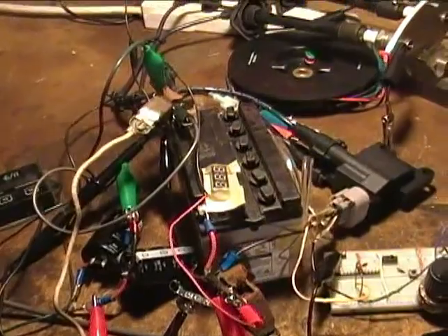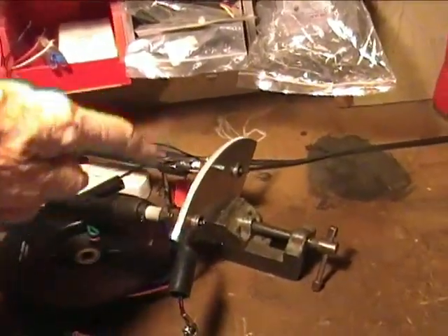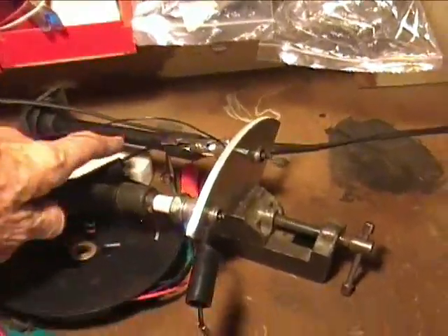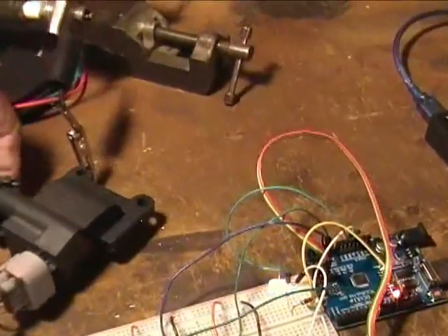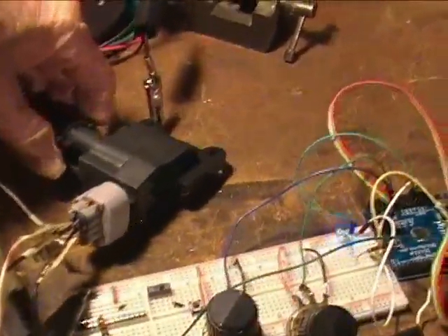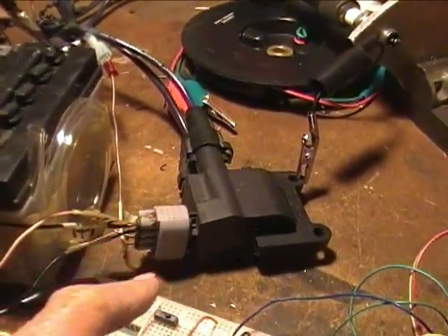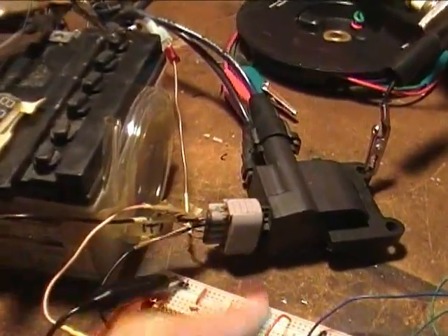This is a look at the hardware. Here we've got two spark plugs hooked to a grounding material, with coil near plug wires coming to the coil near plug coil. This is the input connector with four leads: the outer two being positive and negative, one of the inner ones being a 5 volt trigger signal and the other being a feedback signal.